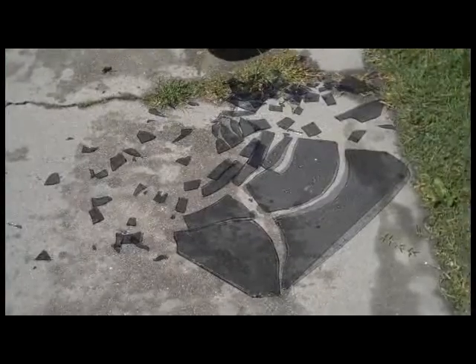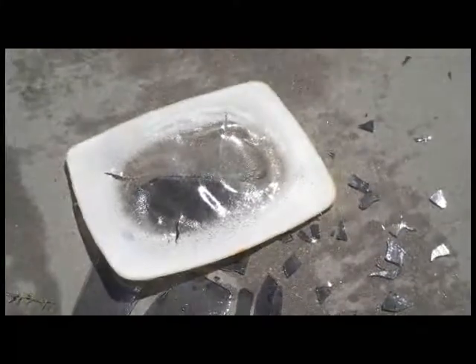So let me get this outside and upside down. The safety glass slid right off and broke, and here's the PVA. So water does cause it to detach. I have a spare safety glass I'm soaking here just to get the excess goo off of it. It's from a Zenith CRT so it's not smoked glass — it's clear, which should be a brighter picture anyway. Here's a spare round tube safety glass that still has the bonding material on it. It doesn't quite fit in the bathtub, so I'm going to have to find a different vessel to soak it in. First thing to do is clean this up as good as possible.